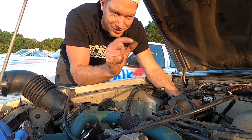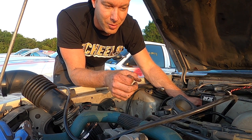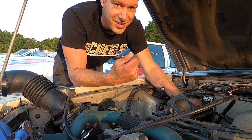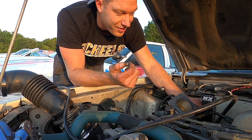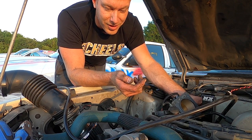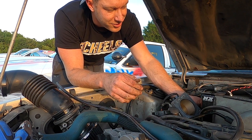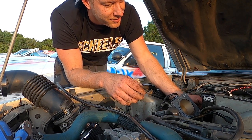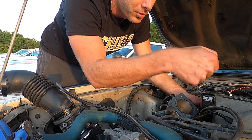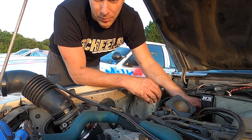When you can't reach one end of the hose clamp to untighten it or even clamp the rubber hose, I was able to get back there with a razor blade and just eat it up until it was gone. Finally got the hose clamp off after I lubed it up, then went to put on the new coolant line, zip tied it on there — and finally got it back together. I put the new distributor cap on, the rotor, and a new coil, so hopefully that solves some of our issues.